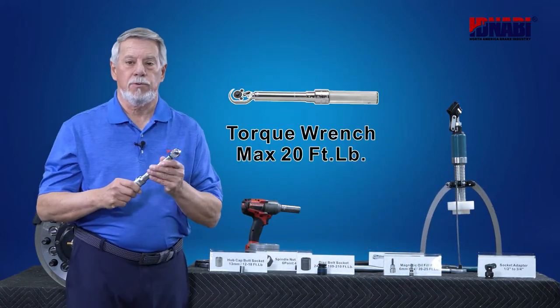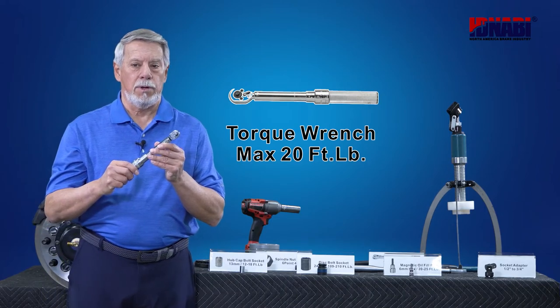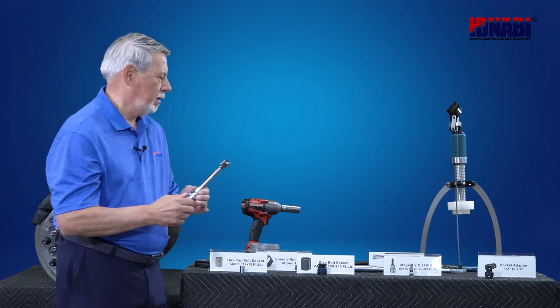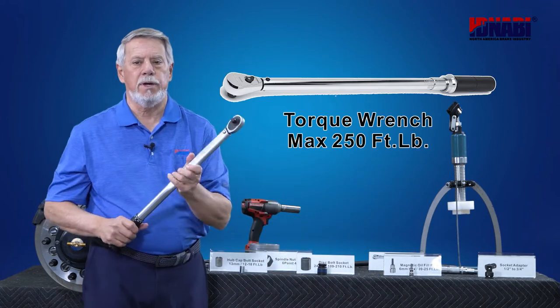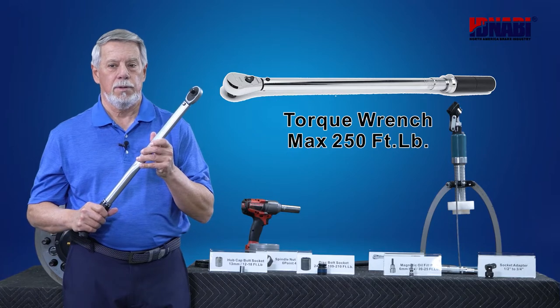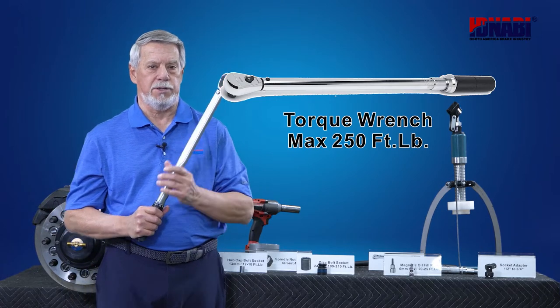Now you're going to need a couple of torque wrenches on hand. The first one is a 20 foot-pound wrench for hubcap torque verification. The second one is a 250 foot-pound torque wrench for spindle nut and disc bolt torque verification.